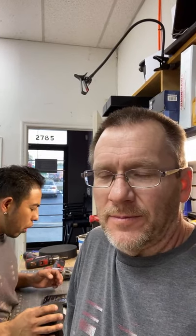Oh, yeah. On the Audio Control, do you use ferrules or no? No. Oh, no, God. On a Phoenix connector? God, no. On the power and ground, you definitely do, but on a Phoenix connector, God, no. Please stop. It's a compression terminal, so it compresses the wire in. It's so annoying to see people use them.